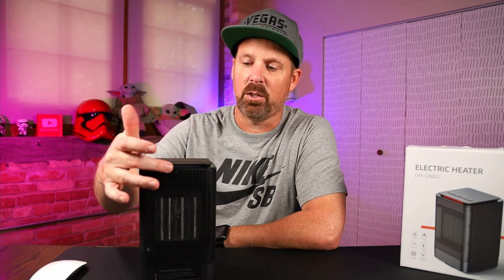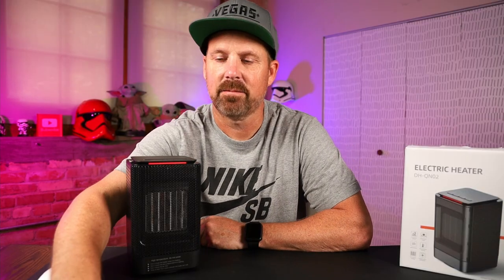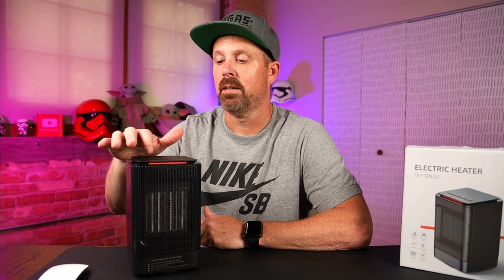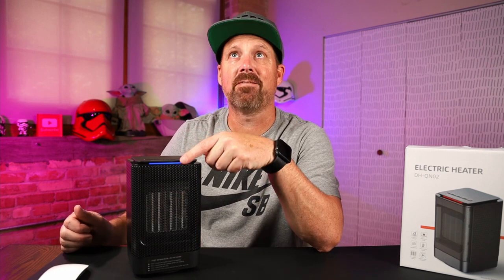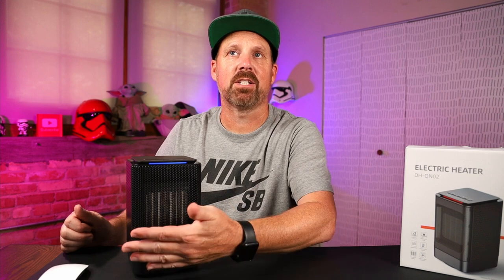Let's turn that off again. When it's heating, you have a red light. If it's bright red, it's on high — the 950 watts. When it's a duller red light, that's the 600 watts. Let's turn it on and take a look. So there is the low — 600 watts — and this is the 950 watts. When you turn it to fan mode, which will still blow out heat for about 15 to 20 seconds, you get the blue light. If it's running and you see no light, that means it's just in its cooldown stage and it's ready to shut off.